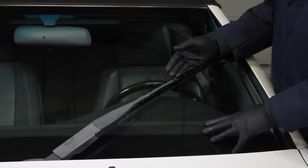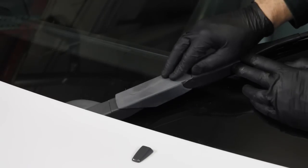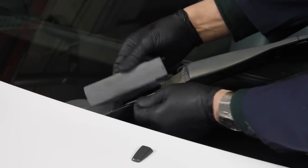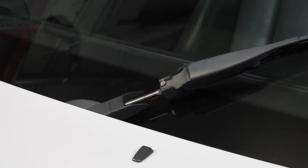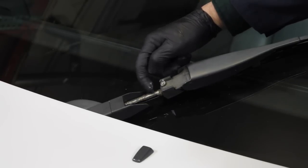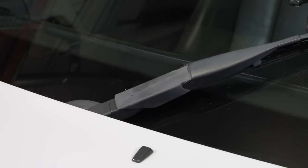That completes the replacement, but there are a couple of things about the windshield and the maintenance of the mono wiper assembly I want to talk about before we wrap this up. I'll use this opportunity to lubricate the articulating shaft on the wiper motor assembly here. There's a cover over the top of this shaft. To remove it, reach underneath and spread the cover apart, pull up on it, and pull it forward to release it from the arm. Then I'll take a little moly grease and lube this shaft up — this will prevent wear and possible problems in the future. Replacing the cover is simply a matter of pushing the grooves back in and snapping it back into place.